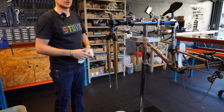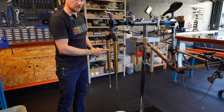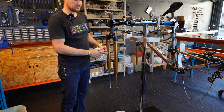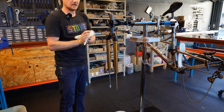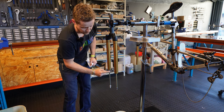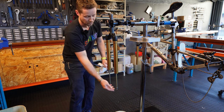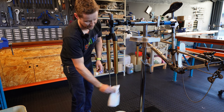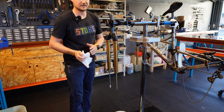Make sure you have an indicator O-ring — if you don't, grab one and put it on once everything's clean. Then do a visual inspection: look for any scratch marks up and down the stanchions on either side. Scratch marks are signs of wear and it's definitely time to get them repaired or replaced. If it's all beautiful and smooth, you're good to go. Also check the rods at the bottom — check the damper cycles smoothly up and down, and the air spring cycles up and down smoothly too. If there's any notchiness or oil leaking at the bottom, bring it in for a look.